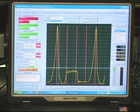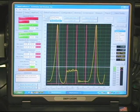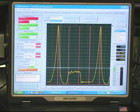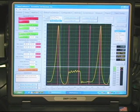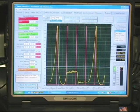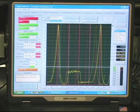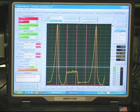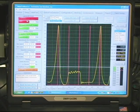The compression is way under target. The target is 56, 57 pounds is what it should be making. We're only making 30 pounds of pressure. So we're 45 to 50% too low on the pressure. The machine is giving that to us. The intake cam is showing a retarded position. This is due to the exhaust valve losing the vacuum.